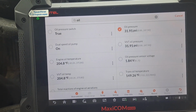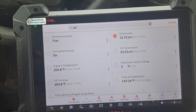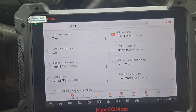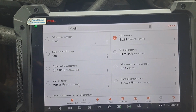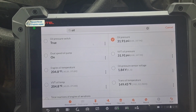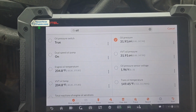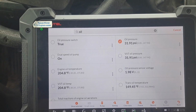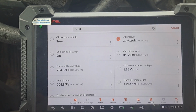The repair went smooth. The only hard part was getting that electrical connector out of the back of the block. As far as removal of the sub-assembly of the oil pan, everything was accessible with the impact gun, no problems. I would use a 15 and 13 to zip them out, pry bar, got the sub-assembly down, and start easily pulling the oil pump out.